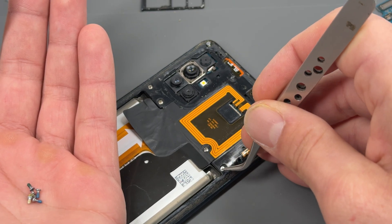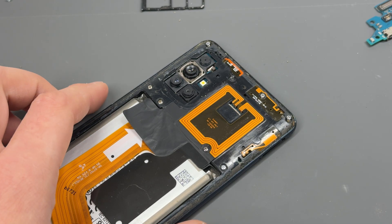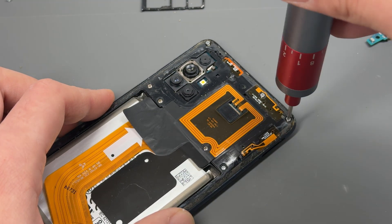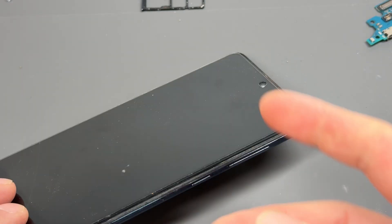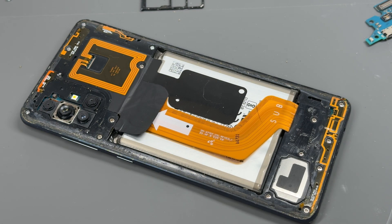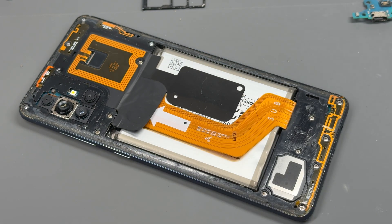When you order a service pack adhesive they come with a load of screws, so I always stash them in one box and when we need them they're always in a handy place. I'll go ahead and torque them up — they're not the exact same screw but they're the same length, which is important. If you put screws in that are too long there's a risk it'll shoot through into the screen or something bad might happen. We've got the charge port installed and the mid frame installed — now we just need to install the back cover. I took the liberty of cleaning it up as well — use a little bit of rubbing action to remove all the adhesive and you'll be fine.